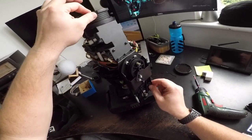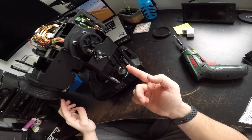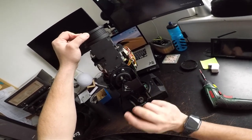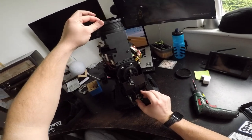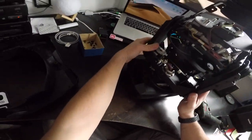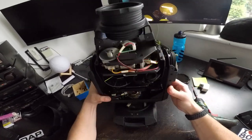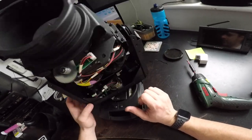A common problem with these — see all this dust? This is scraping, this is the belt failing. It's rubber dust. Usually this belt fails and they start slipping here. Or a common problem I found is this screw fails and then the head just kind of tilts so the belt doesn't tilt the head — it just goes in and doesn't do anything. But the most common problem is this pan belt. For some reason it gets loose and starts slipping. Even if it slips one tooth, everything gets messed up and it starts making a grinding noise and doesn't function right.